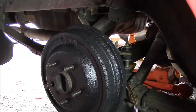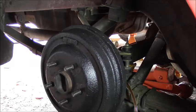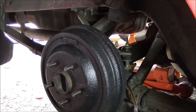I hear fluid coming out. Yep. Yeah, fresh. Check the cylinder. Check for brake fluid. Yeah, I can see she's going down in the smallest reservoir over here. Let me just keep topping this off and we'll pump some more through there, flush that out. Maybe get some nice fresh fluid in there.